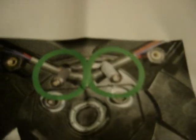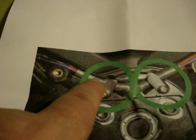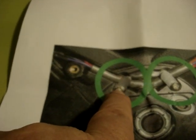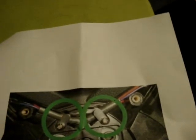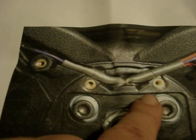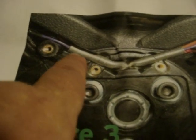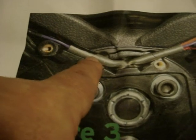Just for reference, if you have the original wiring harness — I assume that has the springs rather than the plastic mesh material — it's going to look like this. What you need to do is take these screws and take this clip off of both sides. When you take the clips off it will look like this: the clips will be gone and the springs are loose, not held down with that clamp. In my case, evidently it's a later production run and they had already changed the harness, so the two that I had don't have these springs around the wires.